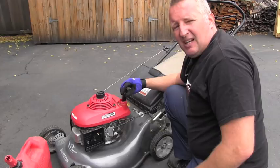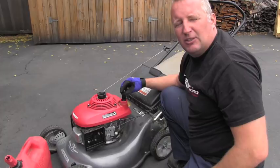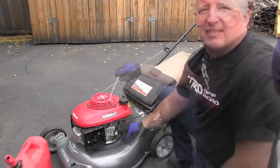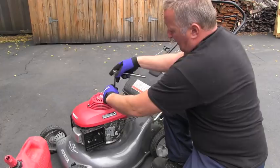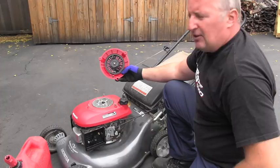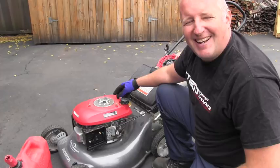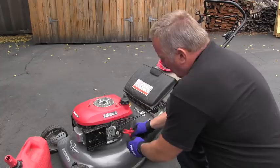I'm going to go ahead and get rid of the dirt, but in this case I have to remove the top and remove the gas tank so I'm able to pull out all that dirt. First I will shut off the fuel line. Using a 10 millimeter socket I will go ahead and remove these three nuts, which lets me move away the starting part and lift the entire tank. This is a fantastic design to minimize fuel spills. I'll use my little fuel line pinching tool here.